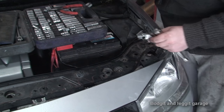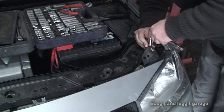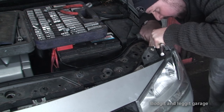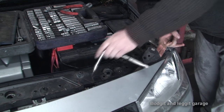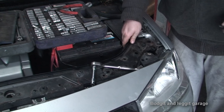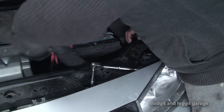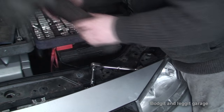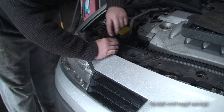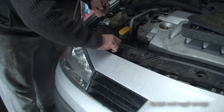There's also air conditioning in this so there's going to be a radiator in front of the actual main radiator, but that shouldn't get in our way for what we're doing. I'm going to disconnect the top headlight bolt. Next thing I'm going to take off is the air intake — that just unclipped and pulled out, so that's now off. I'm going to do the other side now. Just take your time because there are a few bolts we could possibly miss.